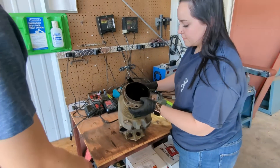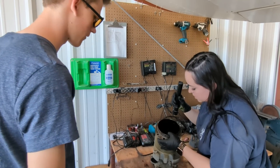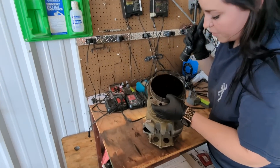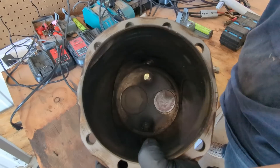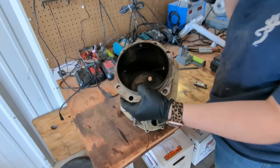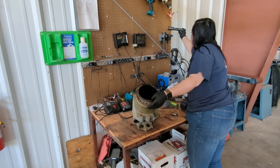And what causes the shape? Is it just the way that oxygen is pulled into the chamber? I'm not sure exactly what causes the shape — it just is the way that they burn. And that it burned irregularly could be that the guide is worn or the seat was worn. Something is worn in there that's causing an irregular burn and the valve not to seal correctly and burn worse on one side.